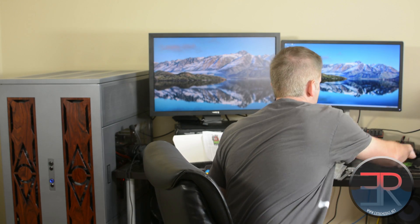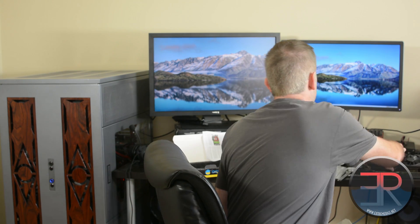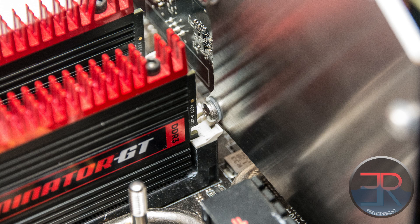This thing does stick out because the bend is actually away from the card, not towards it. Compatibility-wise, this is a problem. We found that we couldn't put the card in the first PCI slot on X79 boards, and it's probably true of X99 too, because right where the screws are attaching - and they stick out because they're button heads - that would hit the end of the DIMM slots on the ASUS Rampage 4. So it does kind of limit where you can put the card.